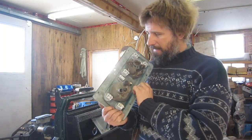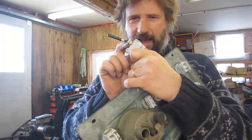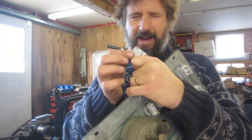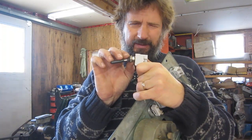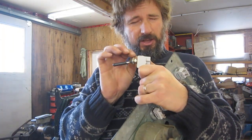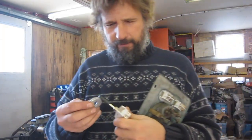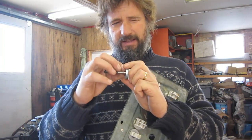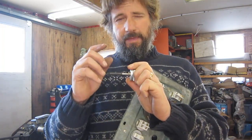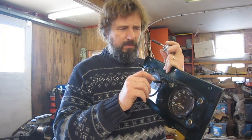A neat trick about the way I mounted these switches: normally on a switch, to set the backspace, you have a nut on the shaft so that you can set how deep it sits in the panel, so by the time you put the front nut on, it's flush. Well, that works great. However, it gives you very little mechanical advantage for the switch, especially on a thin panel. What I like to do is take two very large 1/2-inch washers and slide them on as spacers. That gives me a nice shoulder sitting hard against the switch and hard against the inside of the instrument panel, and it gives me the correct spacing. Much less flex on the panel, plus it deadens the switch quite a bit. So by the time you flick your switches, everything is a lot quieter than it would be with a really light panel switch.